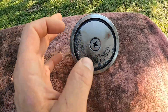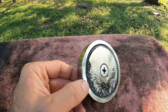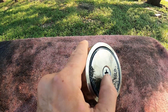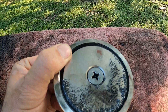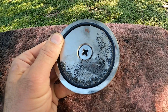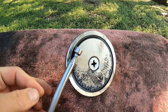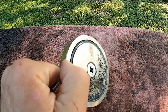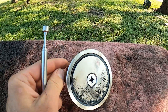What we have here is a 1,000-pound draw magnet, and as you can see, that's not a beard — that is metal shavings. The oil drain plug had metal shavings, and then I pulled the oil filter and ran this other magnet through the veins on the oil filter to get the rest of this out.